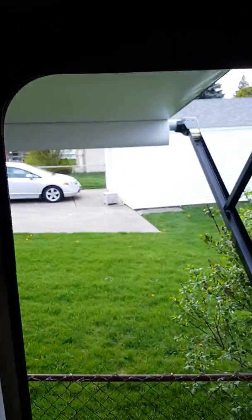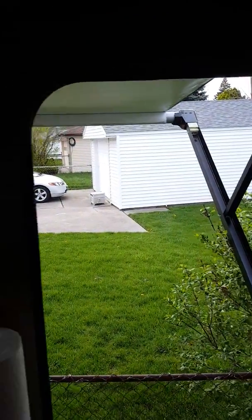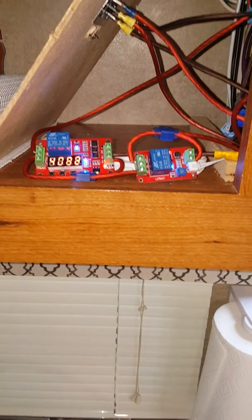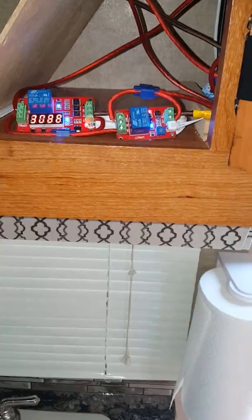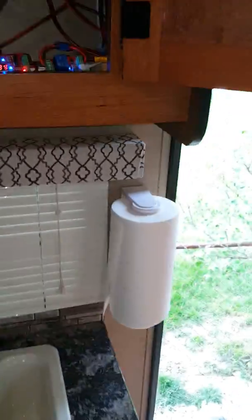The photo cell is right there, taped to the window. I'll use a piece of electrical tape here to imitate night — I'll stick it over top there and the awning will automatically go up. There's that awning going up; the timer is counting down. Basically you have to time your awning however long it takes to close.